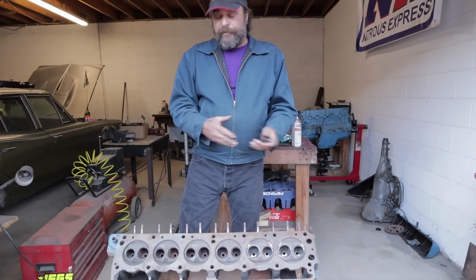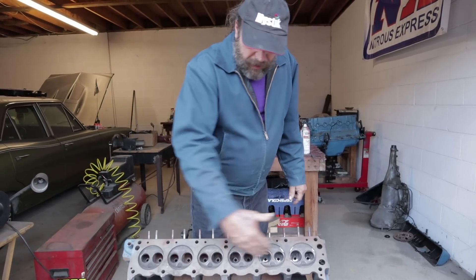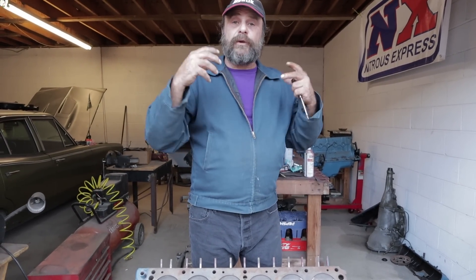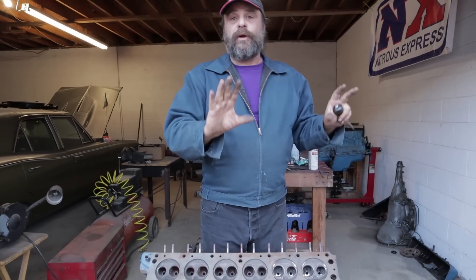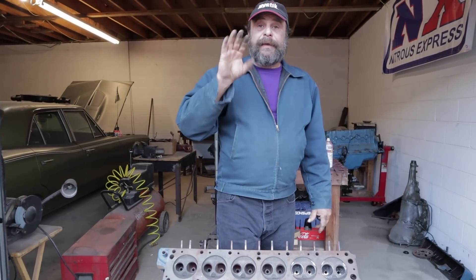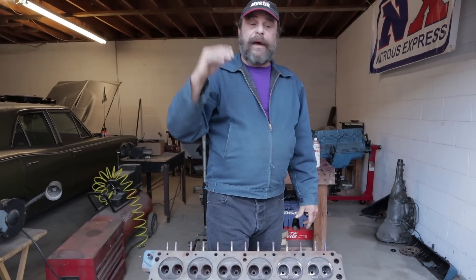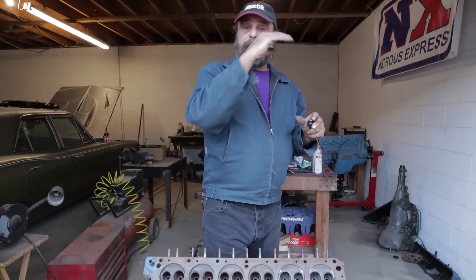We don't have a flow bench — we have a hot rod. I think we can make it work. If we find this thing horsepower deficient, we'll pop the head back off and throw the bigger valves in. After we finish the basic shaping of the ports, we'll leave the intakes pretty much alone — intakes can have a slightly rough texture to keep the mixture from sticking to the walls and the fuel coming out of suspension. It's like the golf ball effect. On the exhaust side though, you want to clean and polish that as much as you can. You don't want the exhaust to have anything to stick to on its way out. Anything that poses any restriction or causes turbulence on the exhaust side has to go, and keep your work to the top of the port — that's what counts. The exhaust is being shoved straight up, so that's the path you want to spend the most time on.